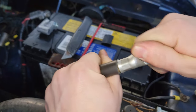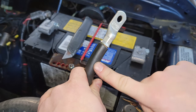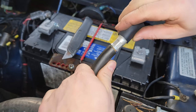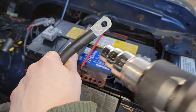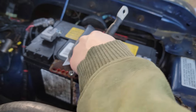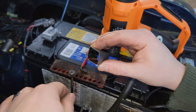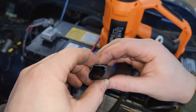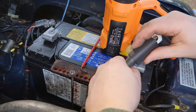I've got it crimped down as far as it can go and backed it off — there's the crimp. I'm definitely not pulling that off. I should have put my heat shrink on before crimping, but I believe I'll be able to slip it over anyway. I'll take my heat gun and shrink that down. Then for good measure I'm going to add some marine grade heat shrink — it has adhesive on the inside. The stuff that comes with the military style terminal is kind of cheap and doesn't have adhesive; this marine grade stuff is much thicker and seals much better, so I'll put that over top and shrink it down.